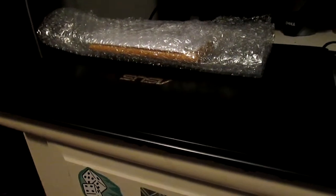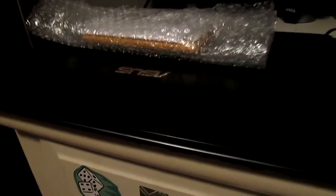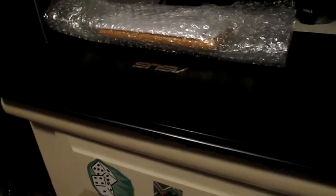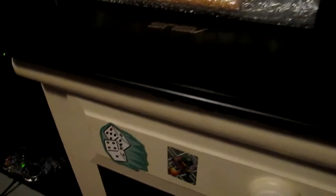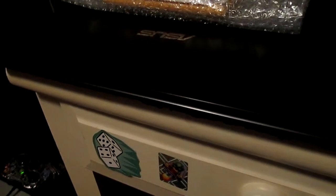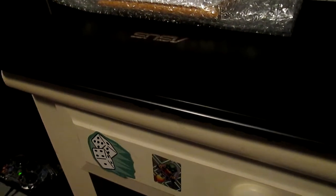Hey YouTube, this is Techmaster2133 here again today. It's kind of late at night and we're going to do a video on how to replace a hard drive in the Asus K55N laptop. The 750 gig Hitachi drive that is in mine has failed. It will still format but it runs very slowly and I can start to hear the inevitable click of death. It has a lot of reallocated sectors. I tried using the Spinrite utility to mark them off or show me how bad the disk is, and it doesn't get past about 3% before it stops or takes hours to progress.